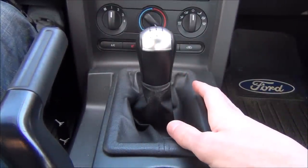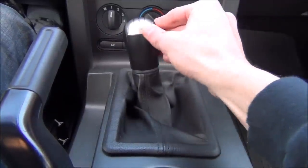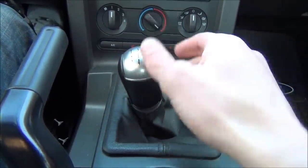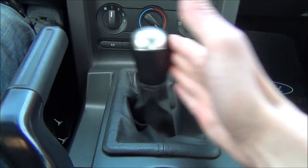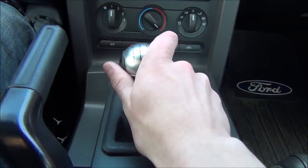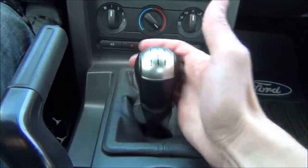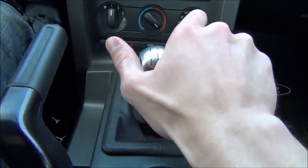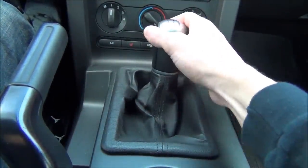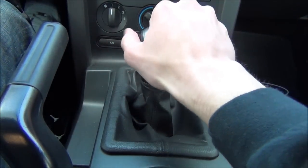Let me slow that down and make things more clear. First is to the left and up. Second is straight down from first, but you need to apply a little leftward pressure so it doesn't snap back into neutral. To go from second to third, you push almost straight up — the shifter will snap to neutral and then go straight up to third. Fourth is the easiest, just straight back from third. To get into fifth, apply a little rightward pressure diagonally. Reverse is a lockout gear — you can't go straight down from fifth; you have to be in neutral first, then it's over to the right and back.